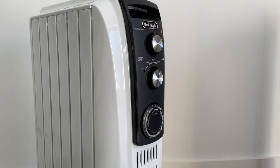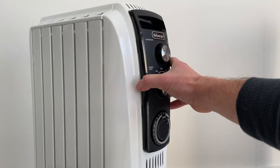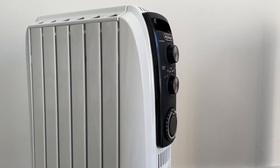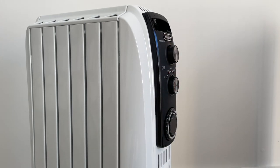It's a good heater — quiet, well-built, and DeLonghi makes really nice stuff. The downside is that it doesn't handle a lot of square footage: 1,500 watts only gets you up to 144 square feet. And it will heat a room well, but it won't heat a person well — the person has to be in the warm room. So if you are cold and you plug this in, it's not going to create any heat for you for an hour or two. The room has to warm in its entirety, not the way a fan-based heater works where it just shoots hot air at you and in 30 seconds you're warmer.